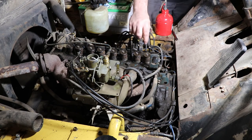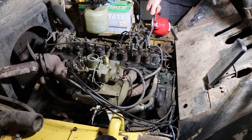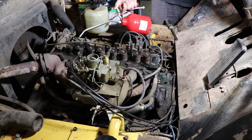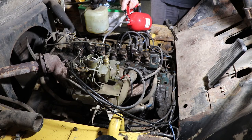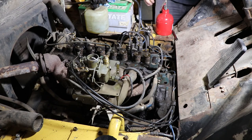So I already went over all of the push rods, and I can feel that they're recessed in the lifter. So I just put a bit of oil in these. It's a bit awkward, but gotta do that. A bit on each of these. So I've already cleaned the bases where the rocker pedestals go. I know that they're clean. The bottoms are still clean as well. So we will drop this in place.